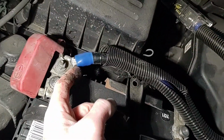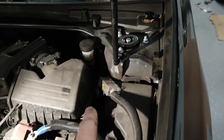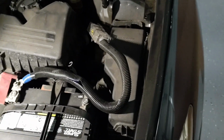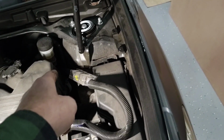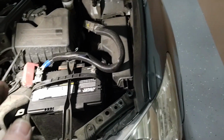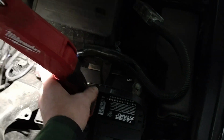However, all their ends that they just hammer crimped down on there, I'm not digging those. So I am going to redo all the ends on all the wire, which means starting from here. And then this one, and I may just have to make a new one if some of these at the end past this are too short. I'm just not replacing the wire from the fuse to the back of the car because it's the same wire I'm going to use. However, the ground wire and this big three still all needs updated, which I assumed it was going to, no biggie.